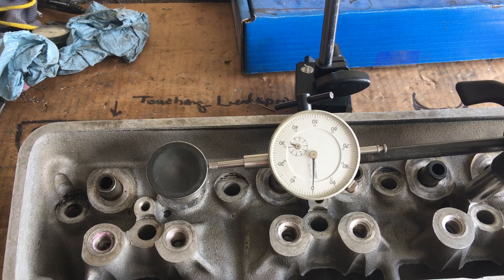We were going to go to some brand new one-piece stainless steel intake valves because we found some damage on one of the intake valves. Plus, several of them, even when you run some green Scotch-Brite over them to clean them off, they act like they don't want to go back in the guide. I don't know if that's an issue from galling or possibly bent stems, but even when you start cleaning the burnt gunk off they don't want to go back in the guides they came out of.